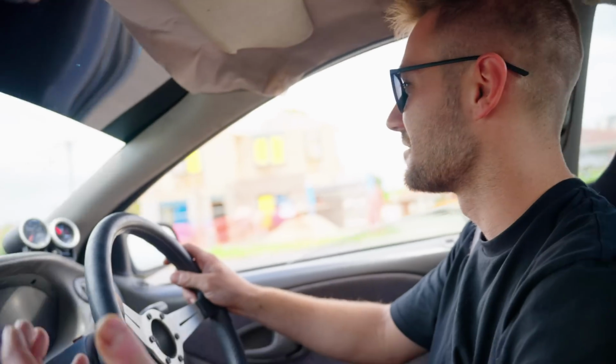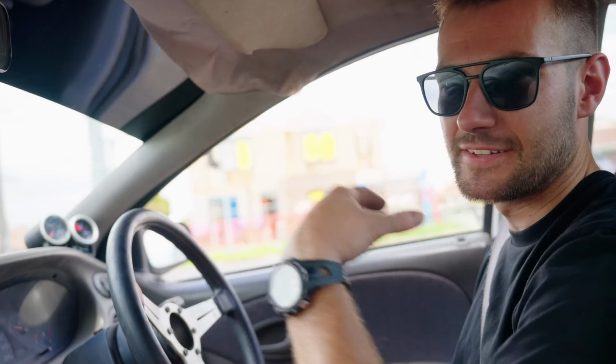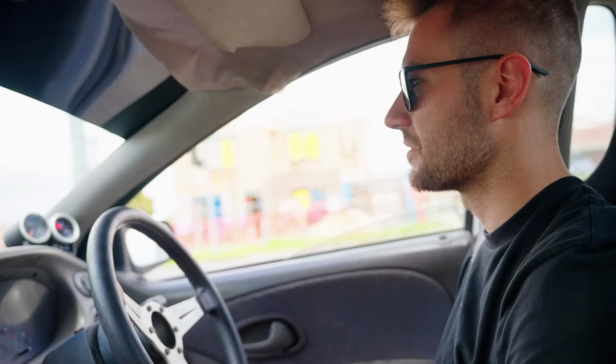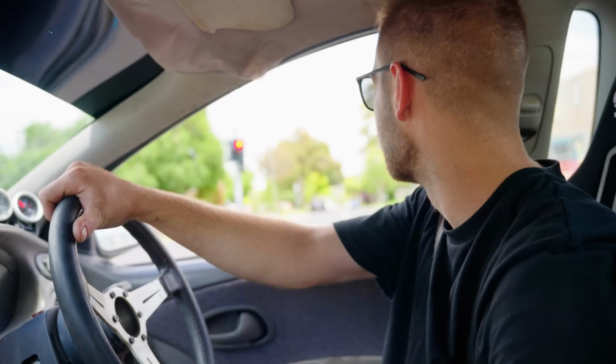It's like the turbo's... I don't understand what's going on. The compressor surge means the turbo's making too much boost for the motor to take in, with too much response. So the motor's not eating the air. But it feels like it's restricting the motor as well, somehow.